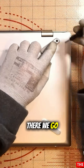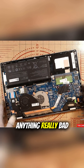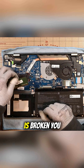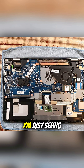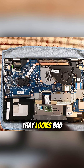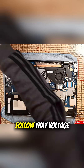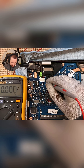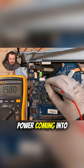We must have some screws — look at that, there we go. Would you look at that? Any signs of anything really bad as soon as we've opened it up? Battery's been taken out. I'm just seeing if there's anything that looks bad. Doesn't look it. And then what about if we put the power in this side, follow that voltage and see — let's go ground here and then on here. Do we get power into the board? We do — we get 19 volts. So there's definitely power coming into the board.